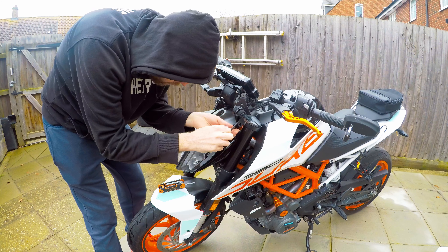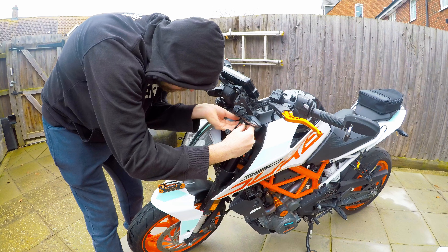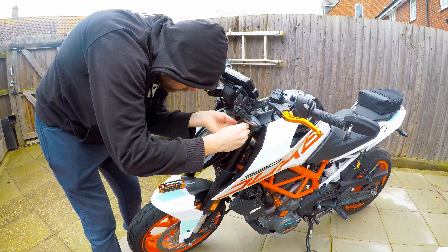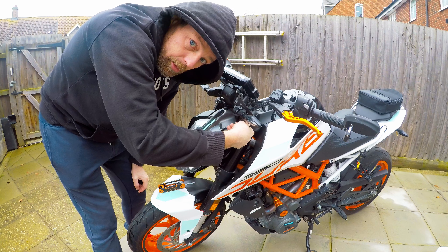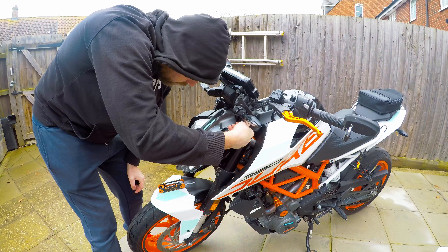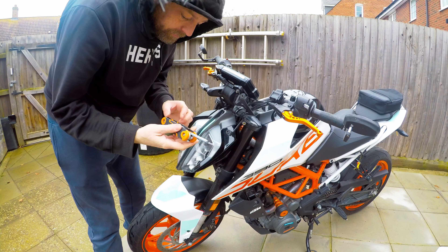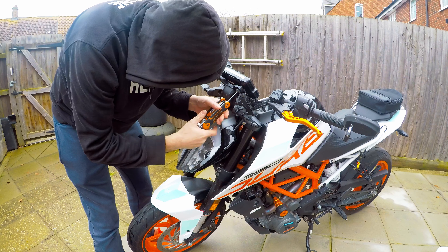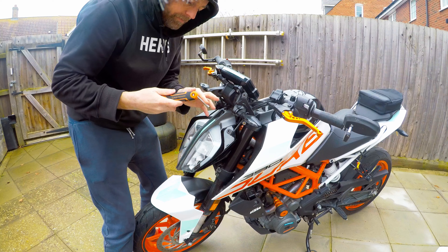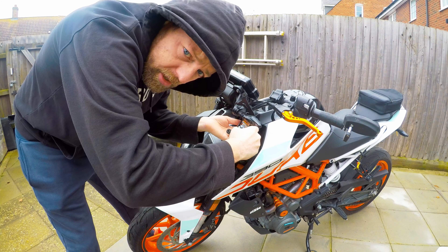The big one is the bottom one — this one squeezes into the hole of the fork stanchion holder, and then the bolt goes through. It's a bit fiddly in there, and the bolt is longer to accommodate that because it's a standoff — it's a washer and a standoff. Allen key, let's do the top one up — three mil for the top — wind this up and get it located. Then the six mil into the bottom.